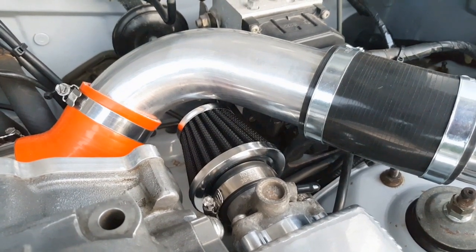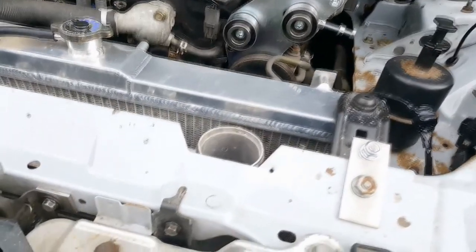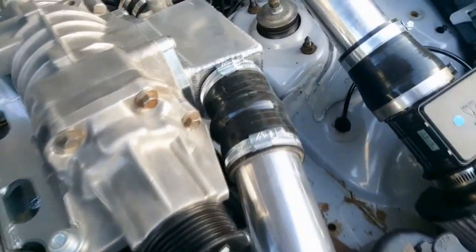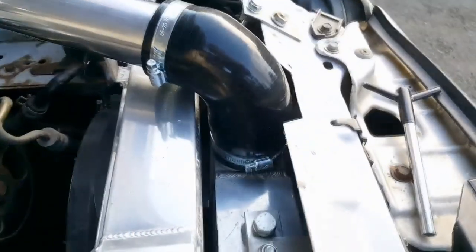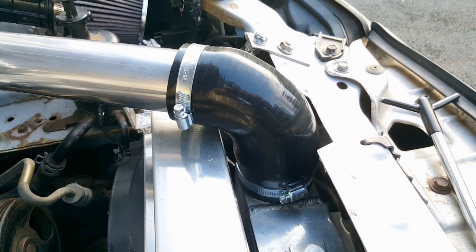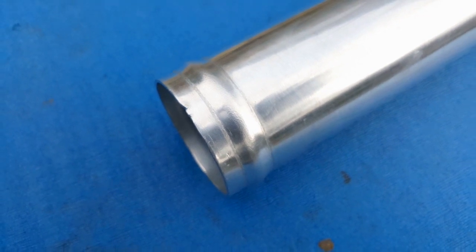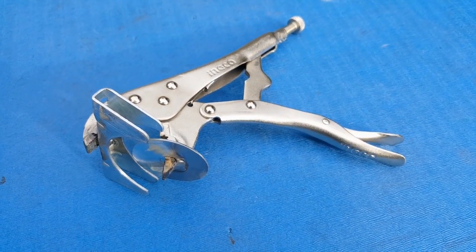I've taken care of the pre-charger stuff, so let's move on to post-charger. First up I need to get pipework from the supercharger to the intercooler, which is actually the most simple part of this job. All I've used is a straight section of 2¼-inch aluminium pipe connected to the supercharger outlet by a hump connector to allow a little movement, then to the intercooler by a 90-degree reducer elbow going from 2¼ inch to 2¾ inch, pushed directly onto the intercooler inlet. I also rolled the end of the aluminium pipe so it can't be blown off under boost, using my homemade pipe swager which I made for under £10.